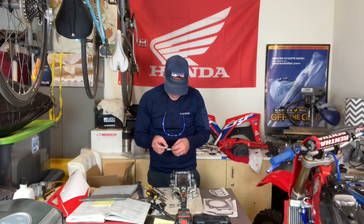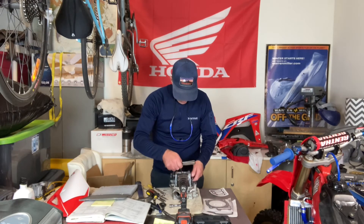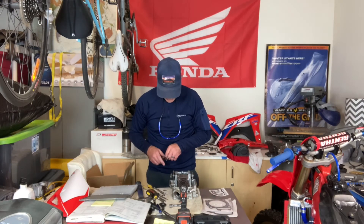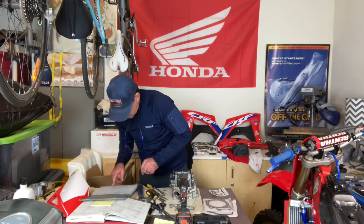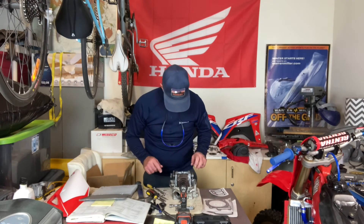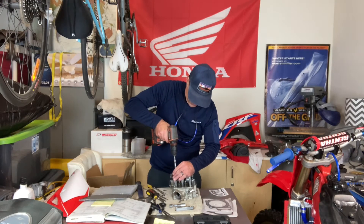We don't want to be over 0.15, so let's see if we can get a 0.15 in there on the left intake — it's very tight, barely fits. So we need 1.2 on the intake. On the exhaust we should probably drop to a 2.1 shim, because we have a 2.1 available and we're nowhere close on the exhaust with the current shim.